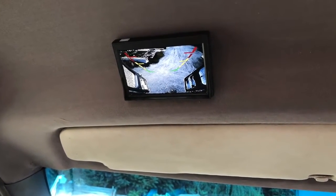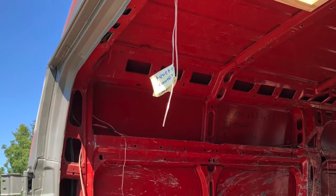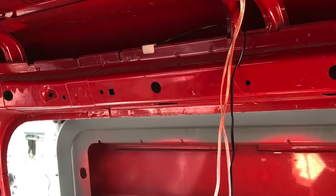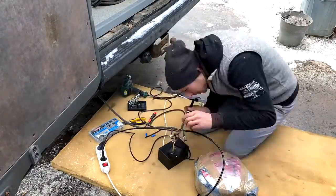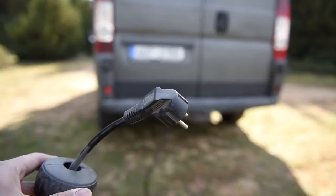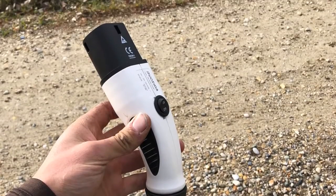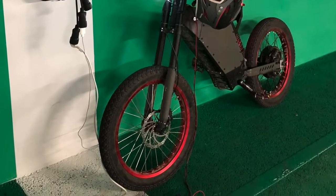In the following steps you can do wires or insulation, whatever you prefer. I decided to do wires. You should have all the wires in protective hoses so you don't cut through them by accident — I learned this later, so please avoid it. Plan it with a marker; that's a good way. Plan your lights, switches, reversing camera, inverter, water pump, fan, and everything else you are adding. I also added an extension cable drum from the bottom of our fan — very convenient to just pull the cable out. Make sure you have plenty of USBs everywhere. I also made a car charging reduction for charging stations so I can plug the entire car and use the power inside, charge e-bikes, etc. A car charger is also a cool thing to have so whenever you are plugged in, it charges your deep cycle batteries too.